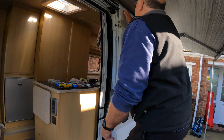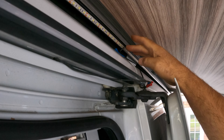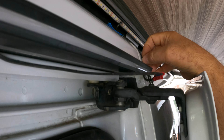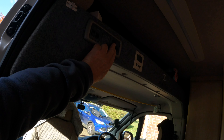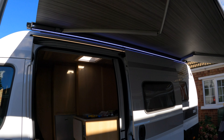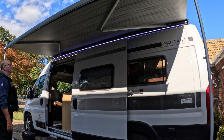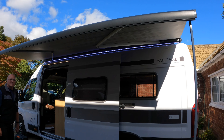What we're doing now is we've spliced our cables up into Mike's old LED light cluster here, and we've spliced the new light strip into this light cluster up here and hot melt glued it into the panel so it's watertight. Before we go any further let's have a test - right, big turn on. Three, two, one - yes! I'm well happy with that. We'll film it again at dusk. We've just got to tuck the cable in and away - simple as that, excellent.